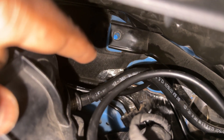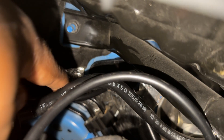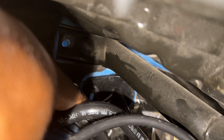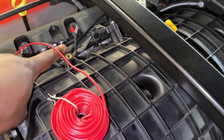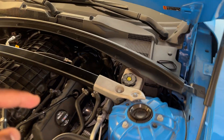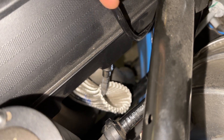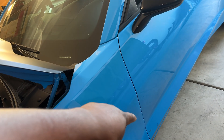Back here, that is where your sound tube delete cover is. I drilled a hole into there and that's how I was able to get this wire through, and I'm working on my ground over there. The first wire — they give you an extension — and down here, as you can see, this wire is connected below to my O2 sensor. Just jack the car up, make sure you have an O2 bung installed underneath, tighten that, and you're good to go.